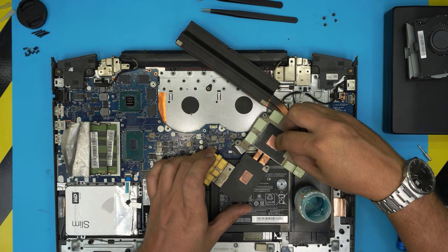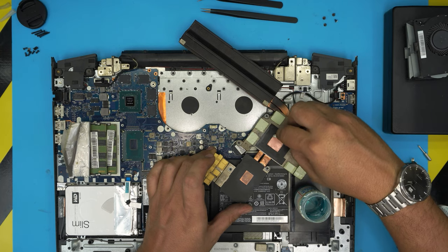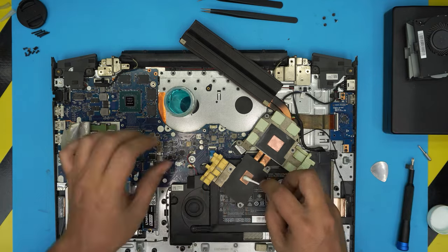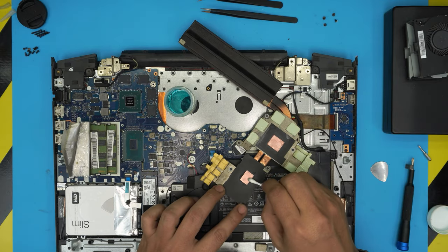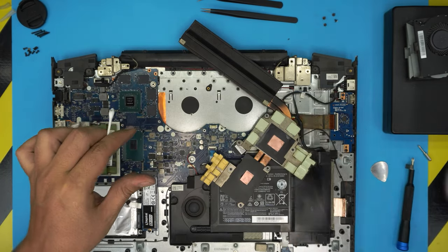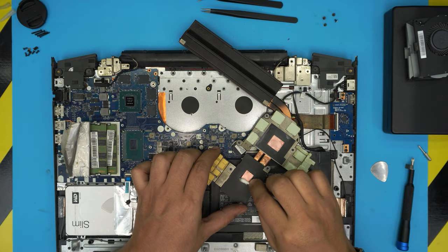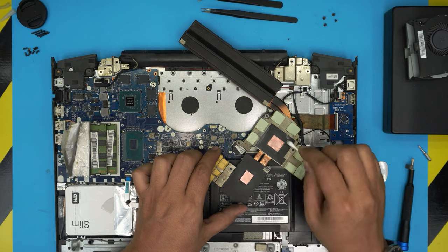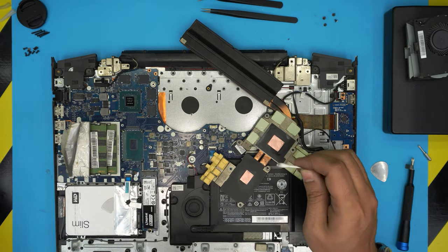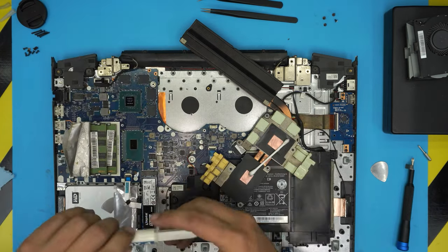So we get the true copper exposed. And once we put the actual thermal paste, there's not going to be enough air in there to oxidize it. I'm going to close this because it smells like a big dump right here. It does oxidize fast because copper reacts to the air. So once you clean it up, make sure you put a pass going through here and apply your thermal paste